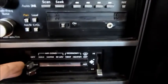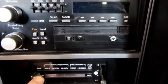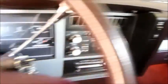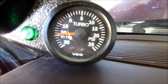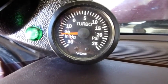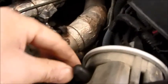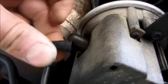The engine has been shut off for a few minutes and I'm going to try to change the air conditioner mode — listen carefully. Hear the mode door changing? So it still has vacuum after the engine's been stopped a few minutes. That tells me my check valve is good and there are no major leaks in the vacuum system. When I pull this off you should hear suction. So the car's accessory vacuum system is working fine.